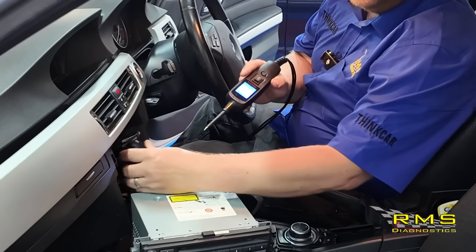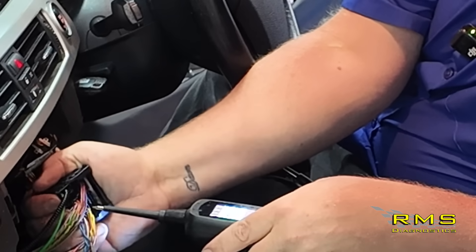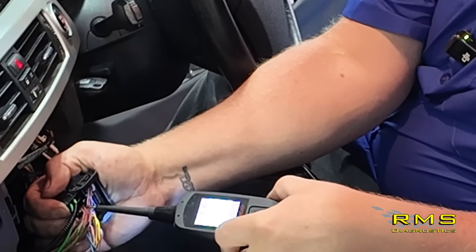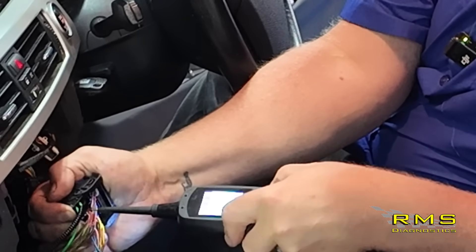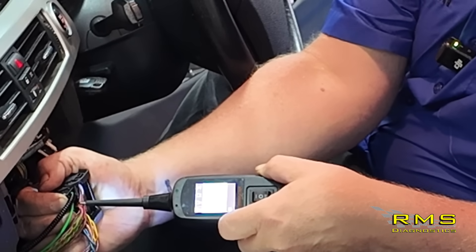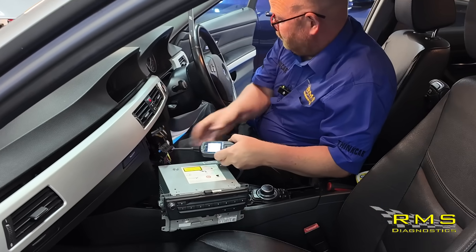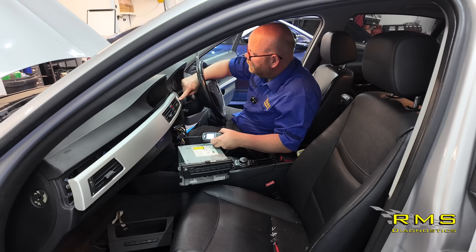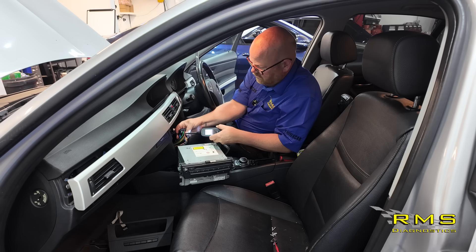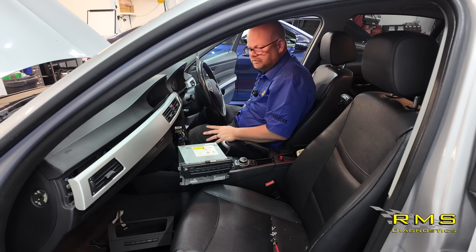This is the main plug at the back of the stereo. We've got a big thick brown — 2.5mm — so that's our earth. Ignition on. The red and green is giving us 2.3 volts. We've got a volt drop somewhere. Let's double-check — ignition's on — yeah, 2.3 and rising. We need to look down that area of the diagram. Let's go and have a look at where it comes from.